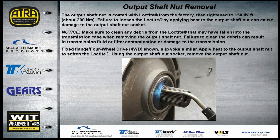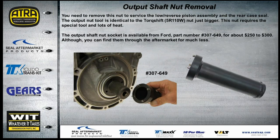The output shaft nut is very similar to the 5R110W and is extremely tough to remove because Ford uses very strong Loctite at the factory. You must heat this up before attempting removal — technicians have gone through several tools stripping tabs by not heating it first. The shaft nut socket is available from Ford and costs approximately $250–$300 USD; it can also be found for less through the aftermarket. It is essentially the same tool as the 5R110, but the nut is bigger.